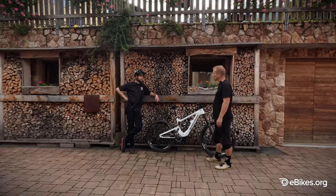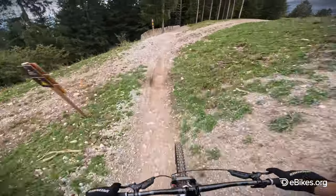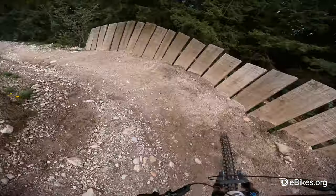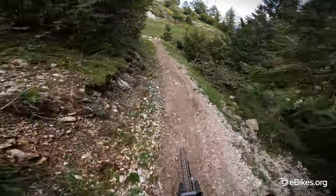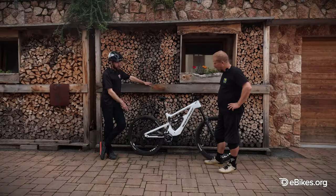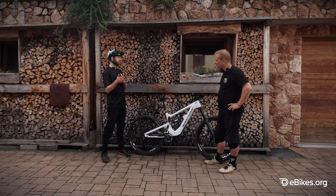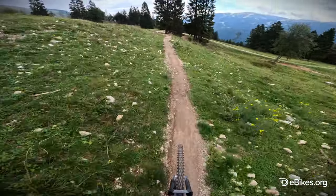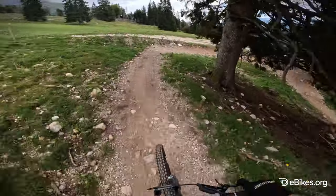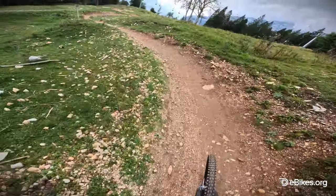What an interesting experience — that's my main reaction. During the descent, the bike just coast shifts down the block. How does it know? We have a speed sensor in the rear dropout on the other side of the derailleur. We use six magnets instead of one, giving a much better speed signal. We use that together with rider input and bike speed data to put you in the right gear as soon as you get back on the pedals when you coast. Coast shift was almost the most useful thing — it really just takes away thinking.